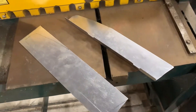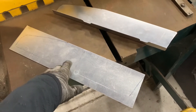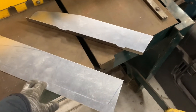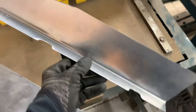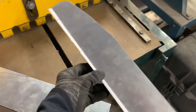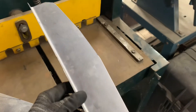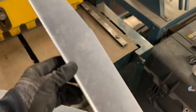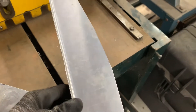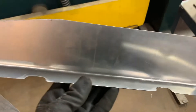Checking back in to show what I'm doing with these block-off plates. I started off with a couple of blanks trimmed down to about four inches by 17 inches, then put a little bend so I have about a one-inch flange on there — that's the side that's going to go up against the radiator. Then I started to shape it, because the upper radiator plenum is at an angle, so I cut in a little bit of shape and eventually got it to fit. It was just a little bit of trial and error.